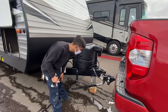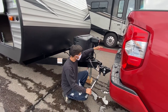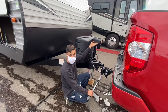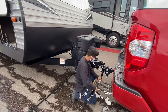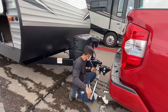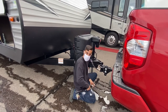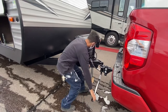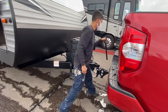When you're at home, you're going to back up your truck, bring this down onto the ball, lock it in. Once you're locked in, raise this back up. Once you raise it up, you're going to take the arm and pop it in to release — the arm has to be in this direction. It has a pull tab over here; you pull the tab, it slides out to go in and locks it. Once you raise it up, swing the bar over right onto here.